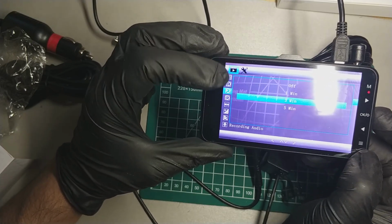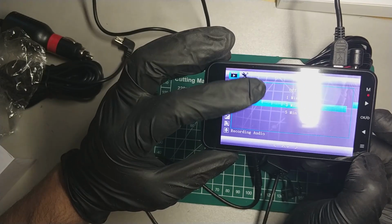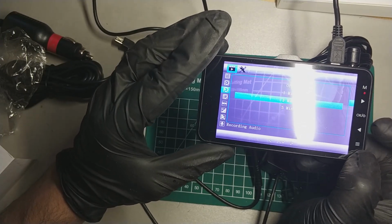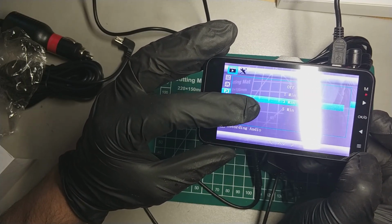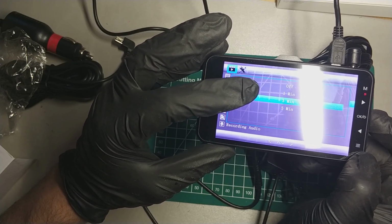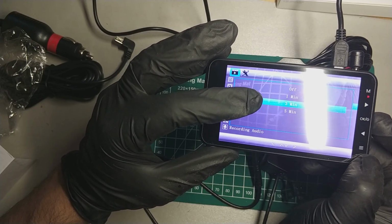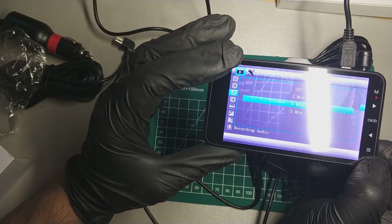Enable loop recording to either 1 minute, 3 minutes, 5 minutes, or off. This is in case it crashes, you lose up to the last 3 minutes. You could set this to 1 minute, but then you'll have lots of files. You can set it to 5 minutes, but then you could potentially lose 5 minutes of recording. This would happen on a slower memory card when the battery is running out, because with MP4 files, the last section of the file is important. There are ways of recovering it by using another donor file, which will capture the end section, and then you apply that end section onto the main video that you've corrupted to restore the file. So there are ways of recovering that, but it's best not to do that.